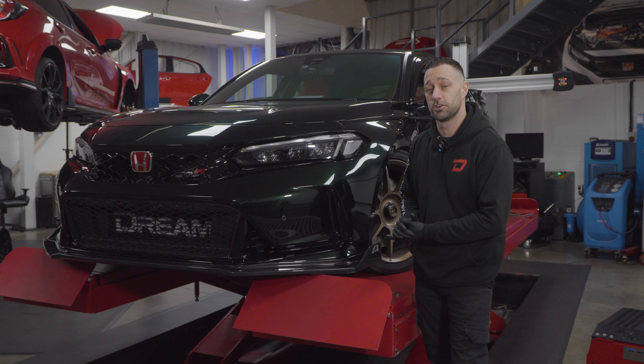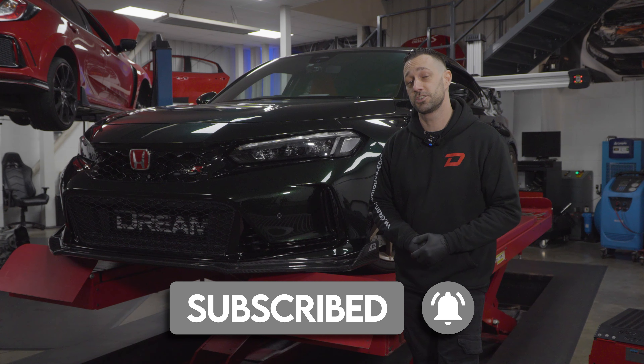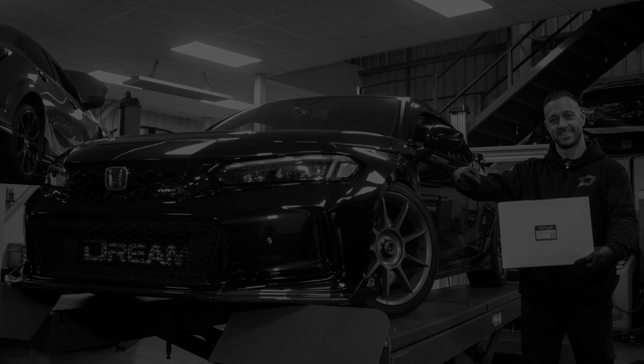A dead easy install and going to offer a lot of rock protection down the side of the car — clearly a lot cheaper than putting PPF on the car itself, so a worthwhile investment if you're wanting to look after your paintwork. You'll notice when I was fitting, both of the clips actually broke — the edges of them came off — and that's clearly another reason why we've been supplied with OEM fixings top and bottom. If you've got a keen eye for detail, you would have seen I've had a little bit of rubbish here from where the car's been lowered with the big wheels and tyres on it. So I'm not too sure how long this clip is going to stay put, but we may end up having to replace it with very similar Honda clips like these. So the driver's side is done and we're going to move over to the passenger side now.